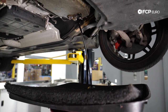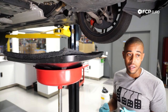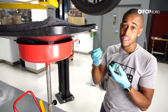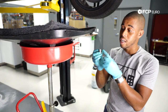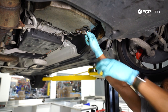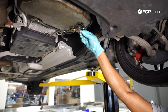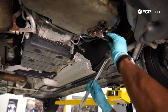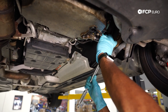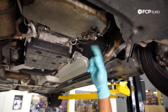That oil is pretty black — it's pretty dirty. We probably need to tighten up the oil change interval on this car to maybe half of what's currently being done. We have a fresh drain plug and a copper crush washer that we're going to be installing. You're always going to want to replace the washer. On Mercedes applications where the drain has sealant, you're definitely going to want to replace it. We're going to send it in by hand first to verify we're not cross-threading. If you can't screw it in by hand, you're probably cross-threading it. When the washer crushes, if you can't feel it by hand, look up the correct torque spec — we'll include it in the description.